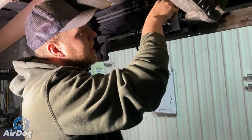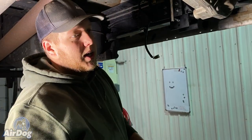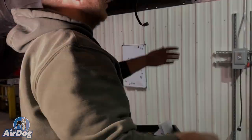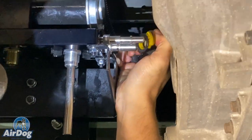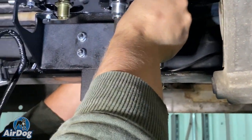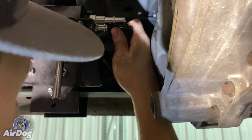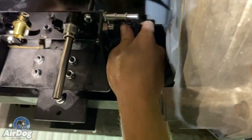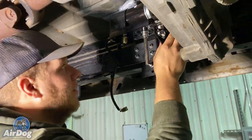The reason we use an aluminum fitting here and not steel is because if this breaks, it won't damage the threads in the base — we can get it removed, get a new fitting, and didn't damage anything internally in the AirDog. On this particular application, we're going to utilize this yellow fitting here — this is going to become your AirDog outlet. You want to make sure we don't fully tighten this in case we need to slide it a little bit so we're not kinking the hose. Get that popped in, make sure the lock pops down. And there's your outlet line — right onto the factory connection, just as easy as that.